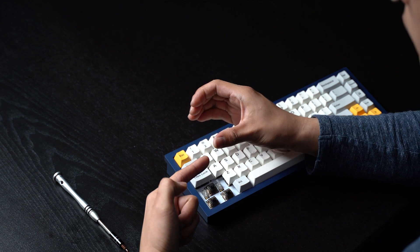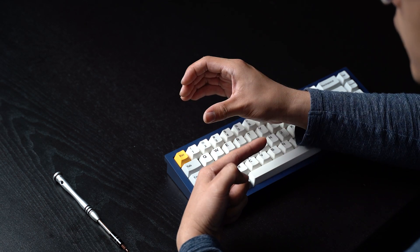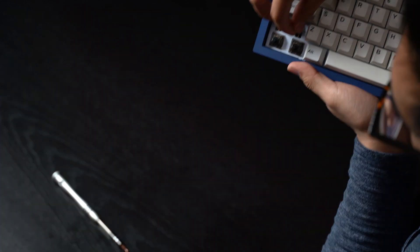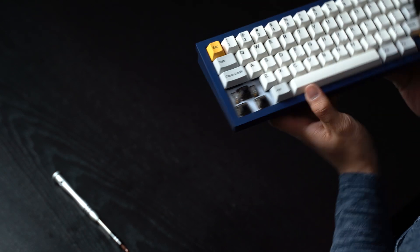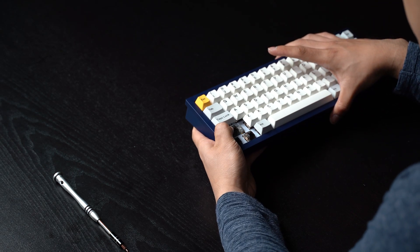You want to get clearance so you can put the stem back. The stem works a little bit like this — you want to pull the wire out so you can move the stem down and use gravity to get the wire back in there. If the wire is currently underneath the stem, lift it up, get the wire out, stem down, wire back in. It's going to be a lot of fiddling, moving around, and jerking the keyboard, but we really don't want to desolder this.